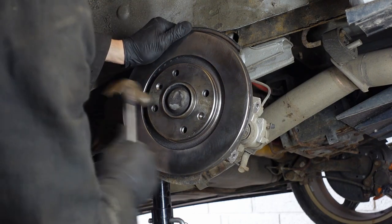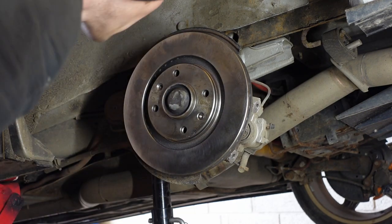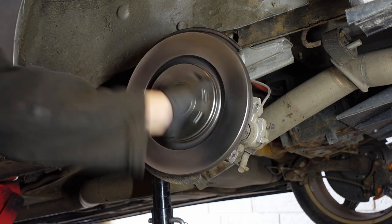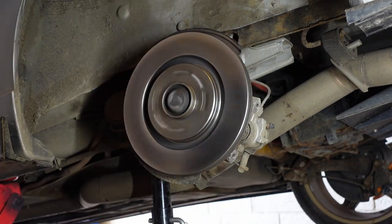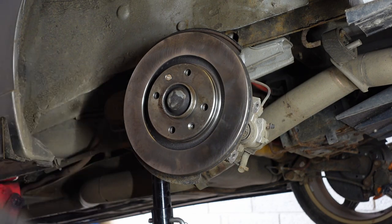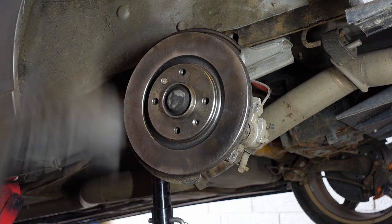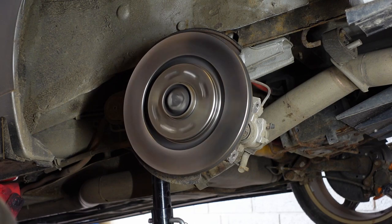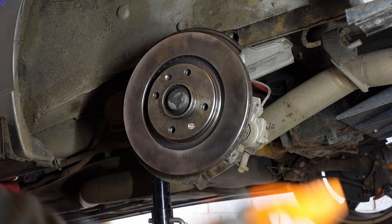Nothing like a hammer! So these discs don't just fit straight on — they are machine fit. The next thing to check is your heat shield. Make sure it's not rubbing. Once you put your wheel or spacer, that wheel will flatten it out nicely. Bolt that disc up — sweet! So all we need to do now is find the bolts we removed earlier, add some thread lock, and fit the carrier.